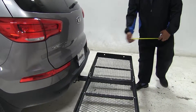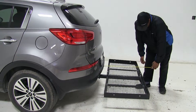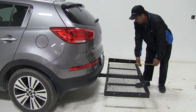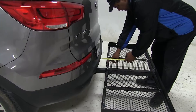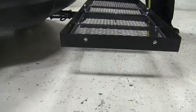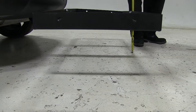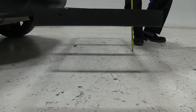First, we're going to make a couple of measurements. Overall distance from the vehicle — I'm looking at 26 inches here. Our closest point will be 3 inches, and for our ground clearance, looking up under the carrier right here, that's going to be nine and a half inches.